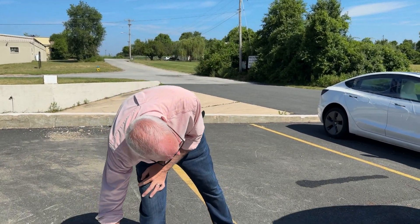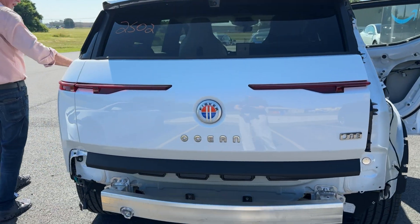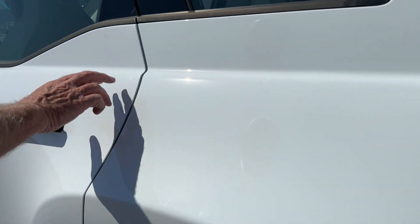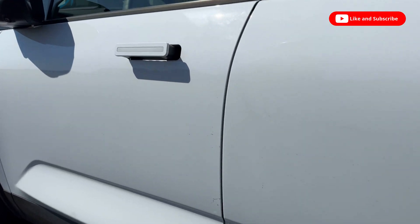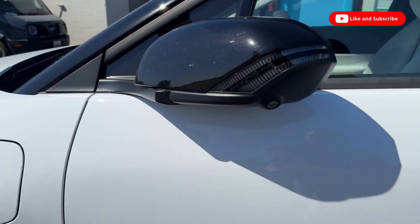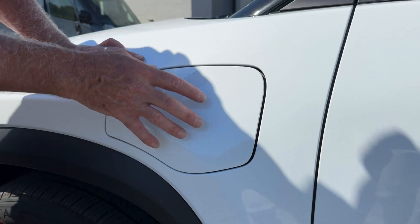We'll go around and look at the other side of the vehicle and examine some of the panel gaps on these mixed metal construction vehicles. Back here on the tailgate to plastic quarter panel, we've got a bit of a V-gap — wider here and tight here. Not perfect but not horrible. This gap is acceptable, probably two millimeters consistently across. This gap's a little V as well — a little high here, a little low there, maybe half a millimeter off. The fit on this plastic panel is tight at the bottom and a little wide here. You may be able to unbolt these and adjust that a little bit.